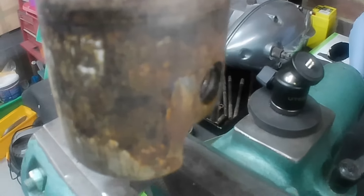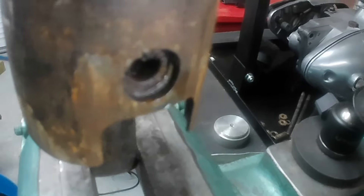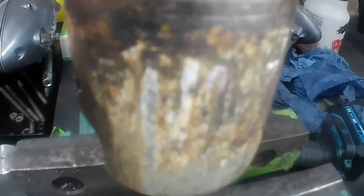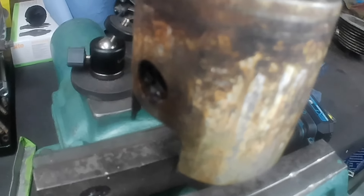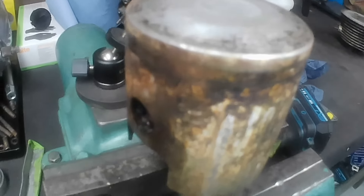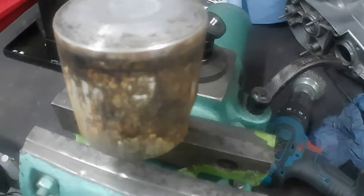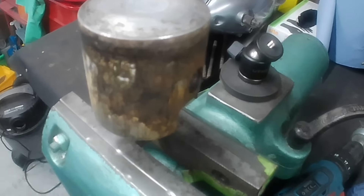Close up of the piston on handheld — you can see the rings are completely stuck, you can hardly see where the rings are. There's rust staining from the barrel and also telltale white aluminium oxide from the aluminium of the piston. Don't leave your motorbike in a garden with the engine full of water for almost 50 years — that's probably the best advice I can give you.